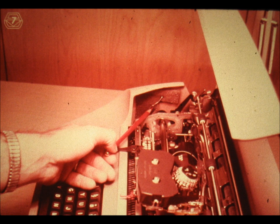Just inside the center section of the machine case, on both sides of the center section, you find these latches. On recent machines, these latches are very short, and you need a screwdriver in order to get at them. Pull them towards the front of the machine. This will unlatch the center section from the bottom cover. If your machine is a very old machine, it may not have this kind of latch at all. If yours should be one of these machines, wait until slide number twenty-one when we will discuss the old-style covers. Let us first continue with our examination of the covers which have latches like these.